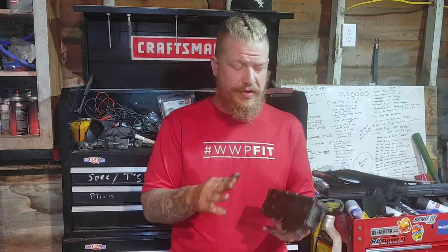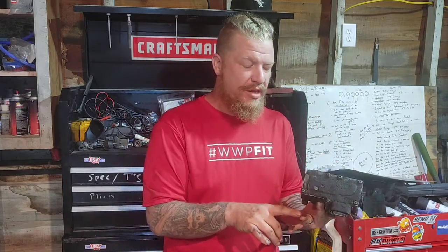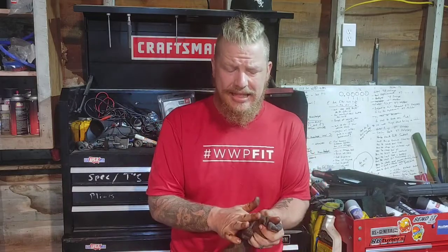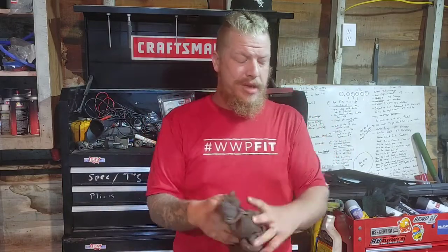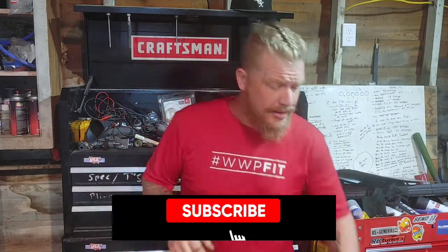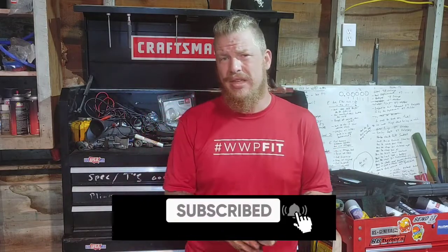I did remove the windshield wiper reservoir, the battery, and move the transmission module out of the way so I could have a lot more room to show you guys how to get in there easily and get more room if you want, okay? I have big hands, okay? I don't like putting them in tight spots, and even when removing the things that I did, I still scratched up this arm pretty good. It looked like I got in a fight with the cat, okay? So watch those points in there, especially the exhaust manifold, okay? It does have some sharp metal along there, so watch that.